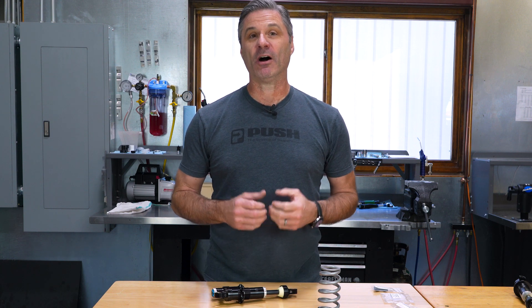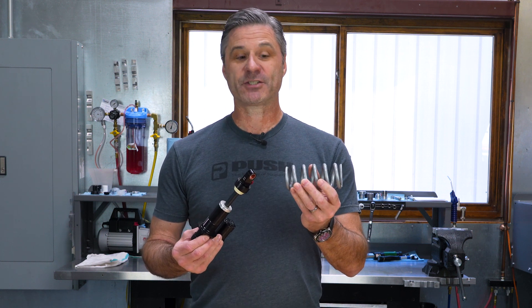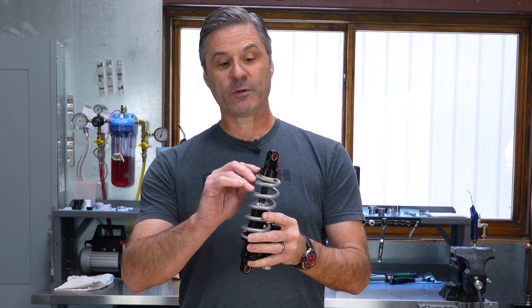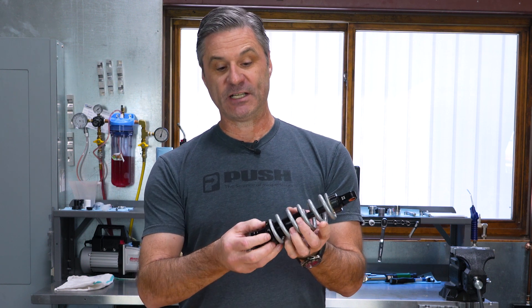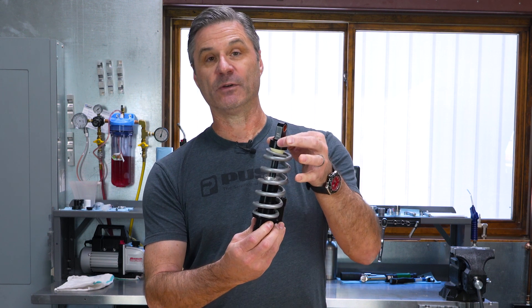Step three. Now that we've confirmed that there's no collision with the frame, we're simply going to mount the spring onto the damper. First, we're going to take the spring and slide it over the damper body. The spring is not directional, so you can put it on in either direction. Once we install the spring on the damper body, we want to ensure that the retaining ring groove is exposed on the spring adapter. If it's not, you can simply use the adjustable spring retainer to dial this down, lowering the spring to expose the groove.